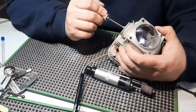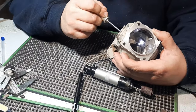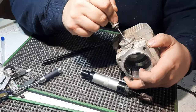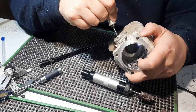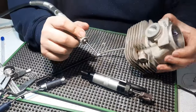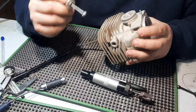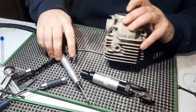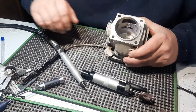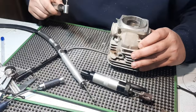That's all I do here - no real big dimples, just a little bit of texture from the burr. We're not changing the shape, not changing the size. Now we'll go in, use our right angle, and get those upper transfers done.